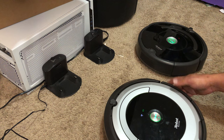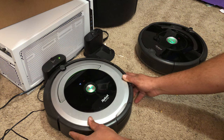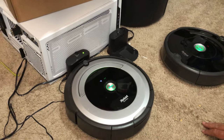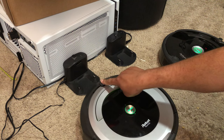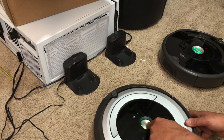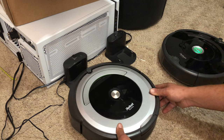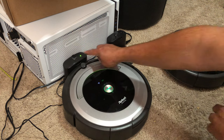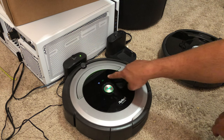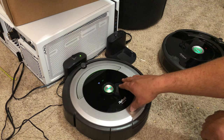Next: is your robot completely dead? If it is, you need to manually align it — just line this top to there. I'm going to line those two up until the green light on the charger comes on and this will start charging. You might not get any display on the robot for a few minutes, up to 15 minutes, depending on how dead your battery is.